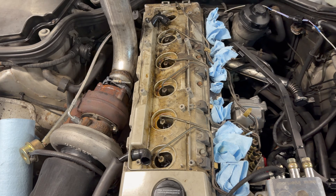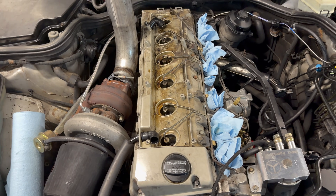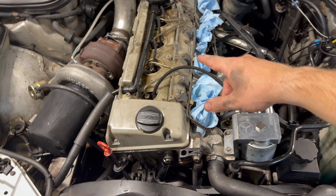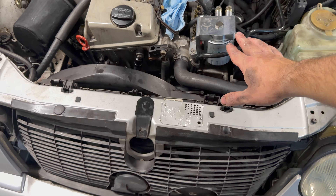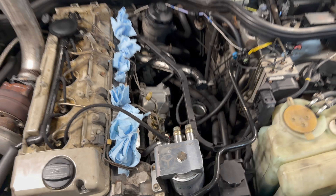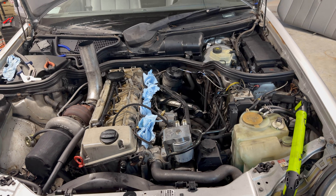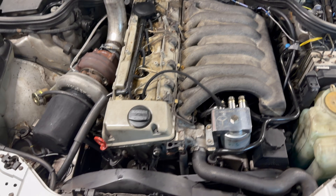Just a little update — took a small break, I'm on the very last injector now. All the others are good to go. To catch you guys up in real time: all the injectors are on, lines are tightened down, return lines are on, new fuel filter is on. Now it's time to put the intake back on. Also got to do the boost, always forget about that, and then plug in the four-bar MAP sensor, and then it's time to crank this pig over.